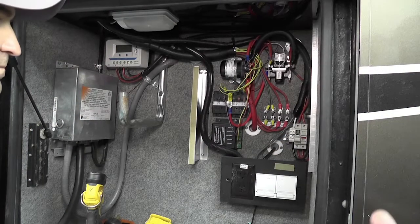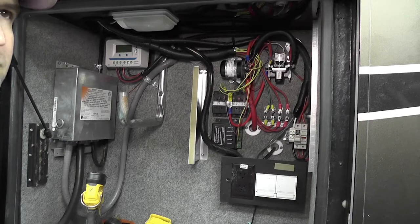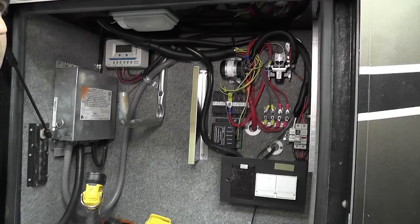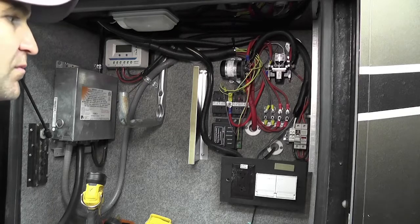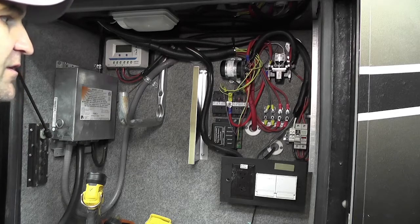Okay. And then when you were doing the install, you could also test for voltage. So you were testing to make sure that you were good from the panels coming down off the roof. Make sure we had our voltage coming down, and then also that we were connected properly to the battery. So we were making sure that polarity was correct. Yeah, before we put any fuses in, we checked the polarity and we made sure that we had battery voltage here at the fuse holder.